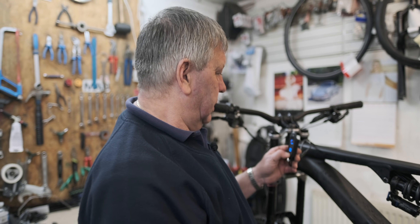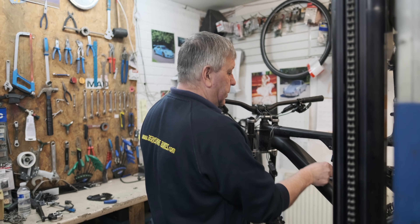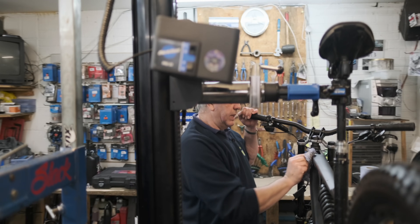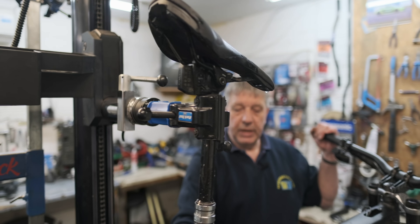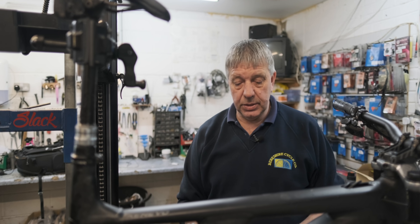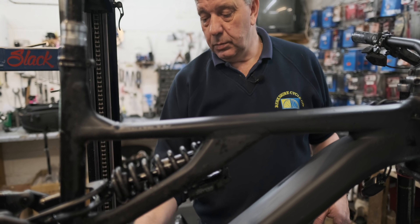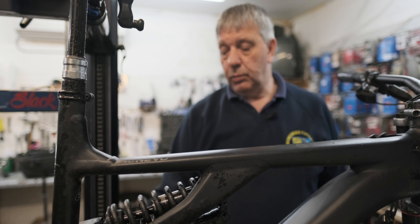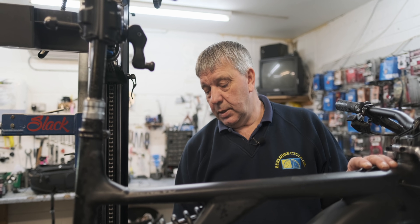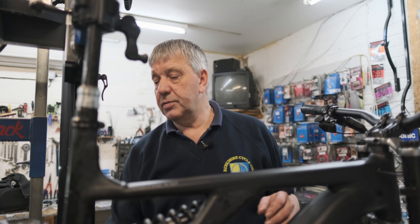This here is just like an ordinary bottom bracket on a conventional bike — get the airline in, blow it all out, get the water away from it, and do the same on the other side. As you can see I've turned the bike on — no red and blue lights. These are the main things: sealing the TCU up, taking the cover off, blowing it all out, giving it a little cleanup — that would do the job and save everyone time because they won't need to keep going back to the shop. One customer said 'we shouldn't need to be doing maintenance on our bike' — but whatever you have needs looking after: your car, your motorbike, everything. You're spending loads of money on an e-bike, so it's even more reason to spend a little bit more time looking after it.